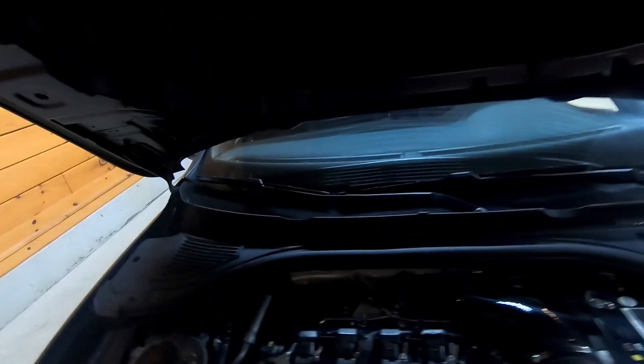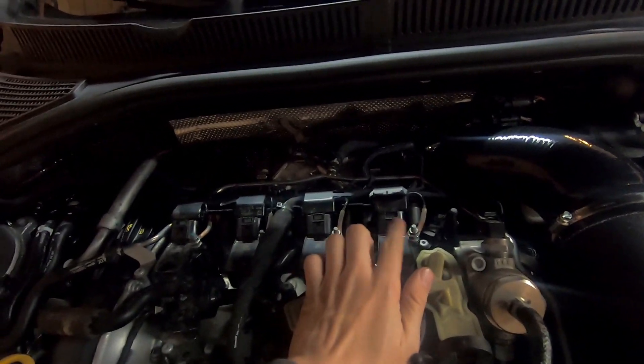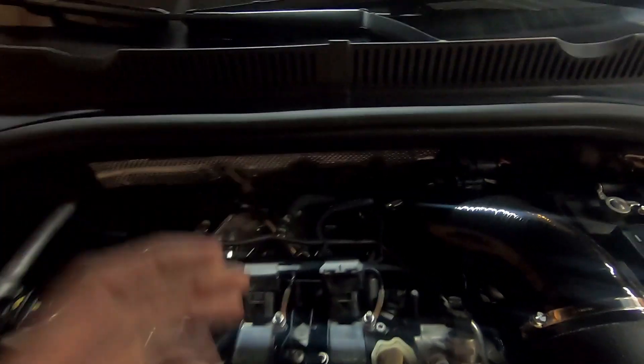If it had the OEM intake on it, I'm sure you'd hear a difference, but you can't even put that on with the OEM intake. It's actually a really easy job — just take the cover off, disconnect your intake piping, take the grounds off, take the stud out on the coil, pull it out, pull all these connectors out so you can move the whole harness, disconnect the mounting screw in the back, and then you just turn it clockwise to remove it. There'll be a link in the description from Integrated Engineering on how to install it.